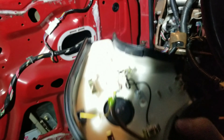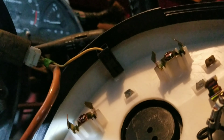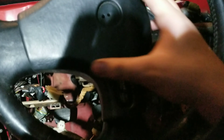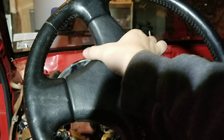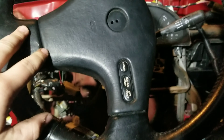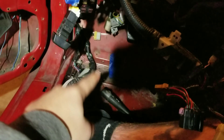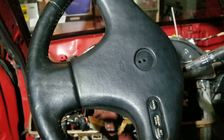Now take your cover — if you popped off the edges, now is the time to put it back on. Plug in that clip. Make sure this connection here is still connected — that's for your horn, otherwise it won't work. Some of you might not have that clip, but this one does because it has all these buttons. Put it on there, push it on, work your way around and it's on. Now your new stalks are on — hopefully straighter than before — and the horn works. Give it a thumbs up if this helped and I'll see you in the next video.